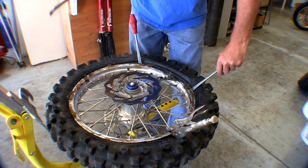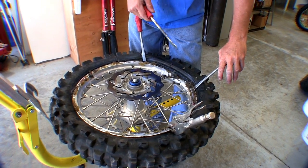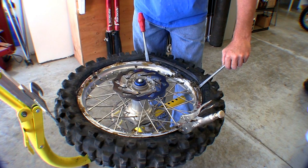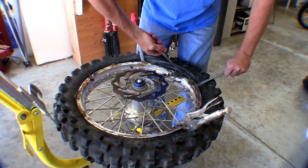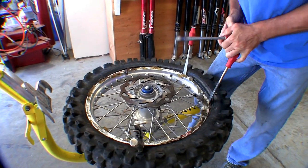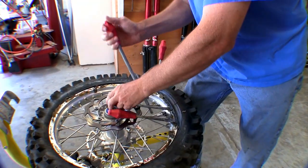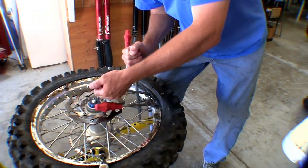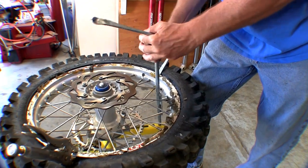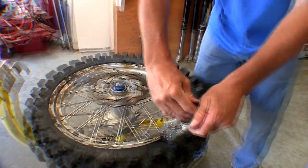Remember, this is a real-life circumstance — a race tire and race mousse. We want it preloaded and stiff. As you get closer to the rim lock, set this up, bring your tool over, stick it in and push on the rim lock, pull it over, pop it in, then give it a once-over to make sure everything's okay. Pull your tire irons out.